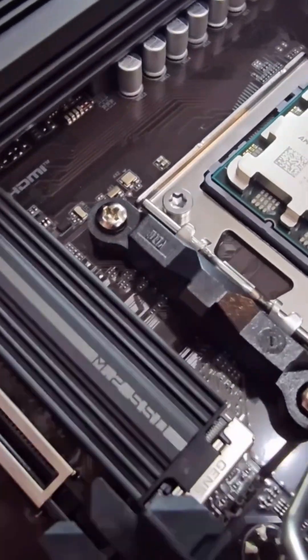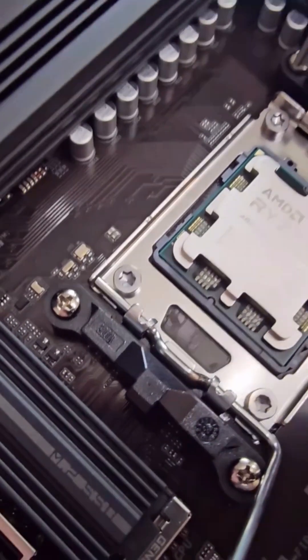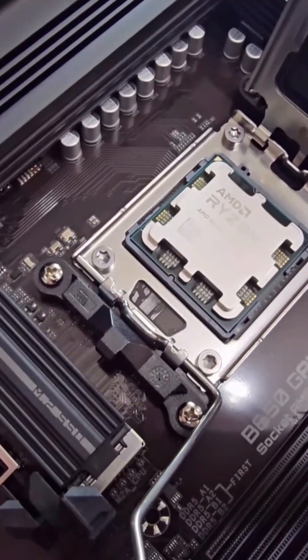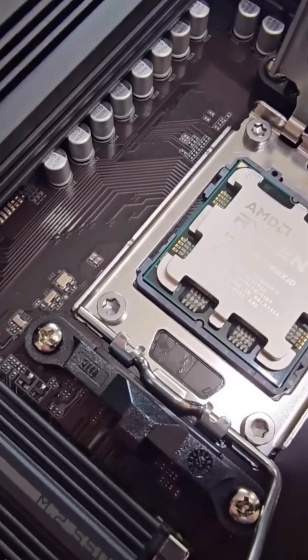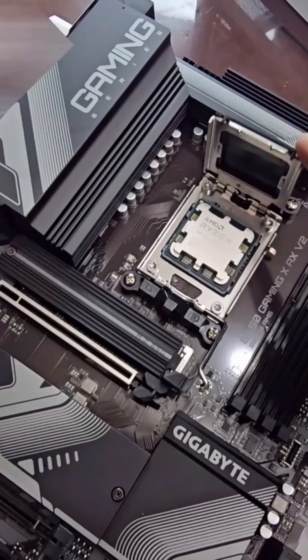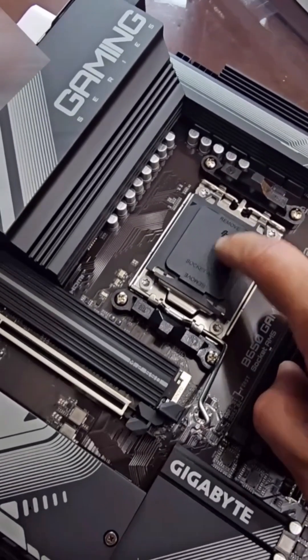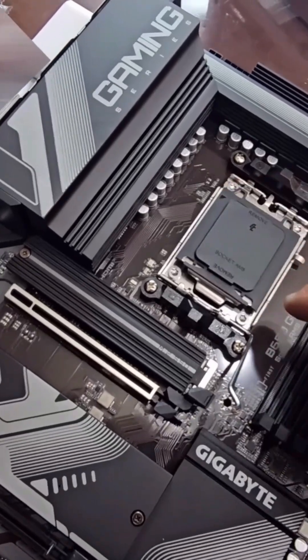It's flush — it was a perfect entry. Like I said, if you need to take it out, don't try to wiggle it because that's how you bend pins. Now the best part: we're going to cover this. Pop this out — that means it's an accessible connection to the CPU and the motherboard.